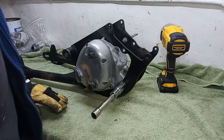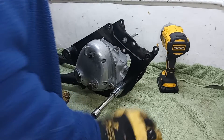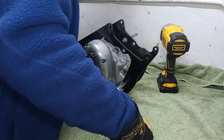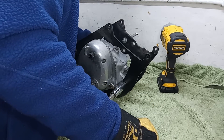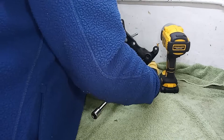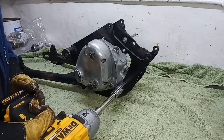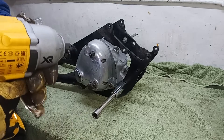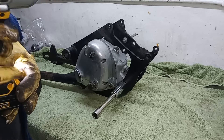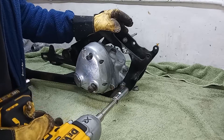We're just going to undo the remaining mounting bolt for the gearbox and see if we can remove it from the cradle. I've got a 7/16 Whitworth on this side, and as seems to always be the case on this bike, a 3/4 UNF on the other side — there doesn't seem to be two nuts the same, though the thread must be the same. Right, we're on undo — medium power I think is all we need — and off it comes.